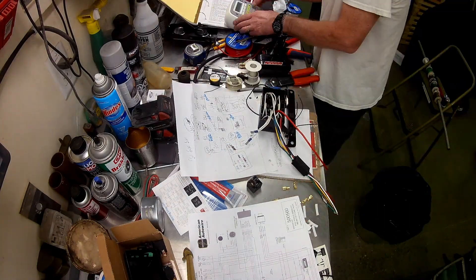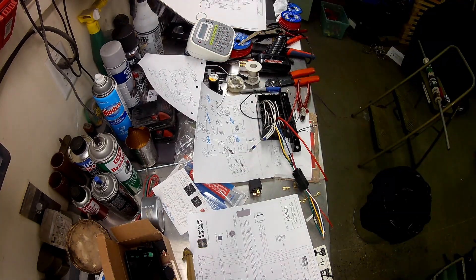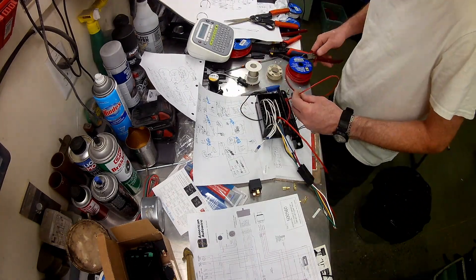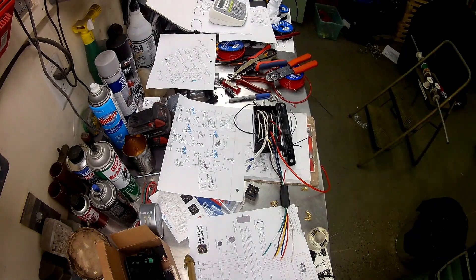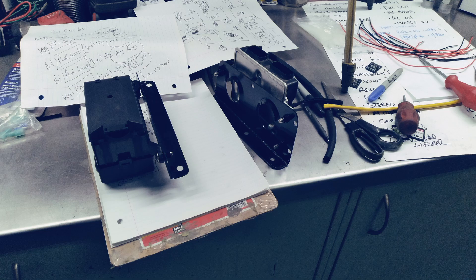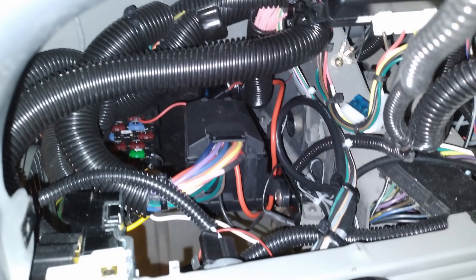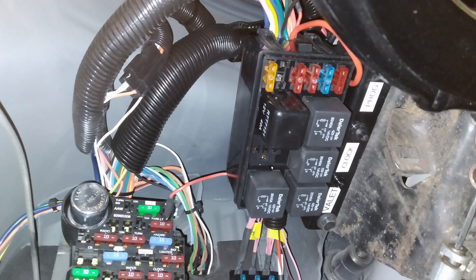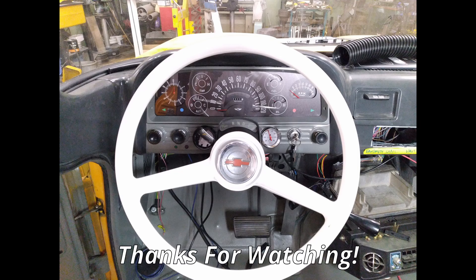You can see a kind of connector in there for the relay block — I ended up not using that. My idea was if I ever had to take it apart, I wanted to be able to unplug it from the rest of the harness, but that became a bit of an issue, so I ended up just hardwiring it into the vehicle. I have a Brother brand label maker because I wanted to label things — by the time I get it to the vehicle, I'm going to forget where it all went. Here are the two brackets ready to be installed. The throttle actuator is on the right-hand side, tucking in right behind the key, and the relay block is there. The underside is a lot more tidy. You can see the one relay I did not use. It all fits behind the gauge cluster. We're going to find out pretty soon if it works, because we'll be making this thing run — so be sure to check in. As always, take care, thanks for watching, and we'll see you again.